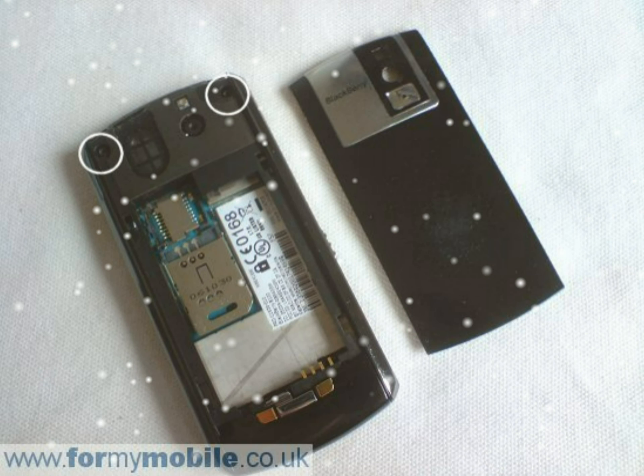Your phone should look like below. Turn the phone over, then remove the two screws you have access to. Run your plastic tool along each side of the phone to release the two chrome bezels.